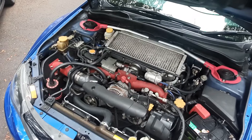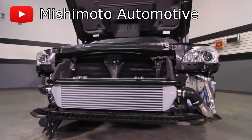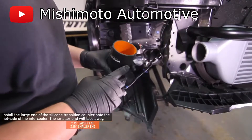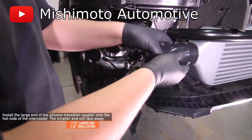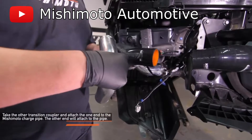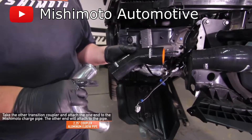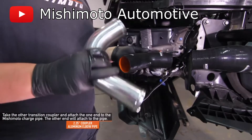This lack of space for larger intercoolers is what causes many to convert from top mount intercoolers to front mount intercoolers, most commonly seen in Subarus. Additionally, the claim that front mount intercoolers increase turbo lag is not as bad of a disadvantage as people say it is, if it could even be called one. From a theoretical standpoint, there is around 0.2 seconds of additional piping for the air to pass through. This tiny difference is practically next to nothing, especially when it can easily be countered through a fresh tune of the ECU. Additionally, since the intercooler piping is pressurized, this lag is negligible.